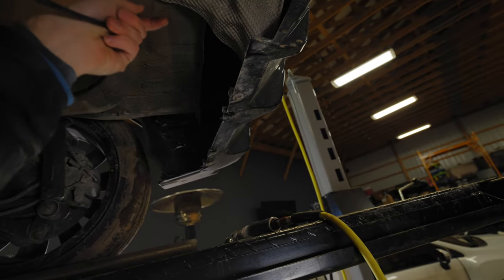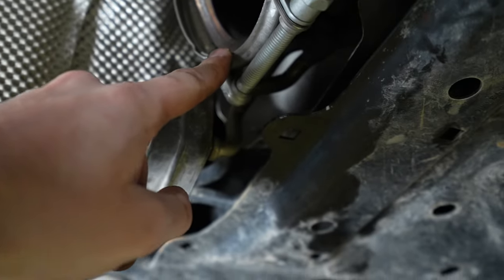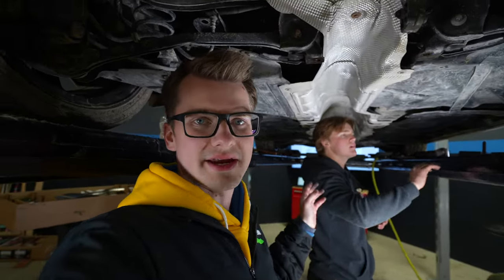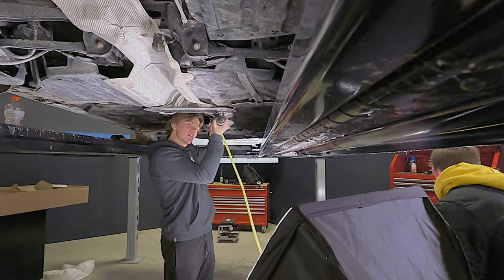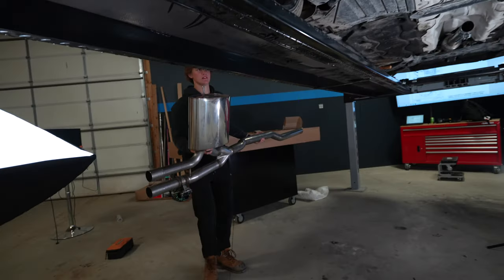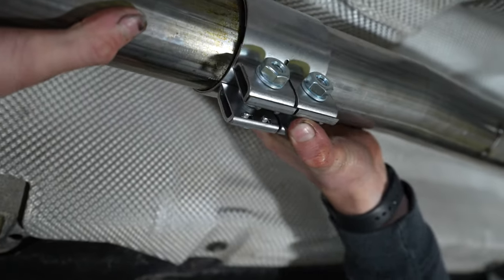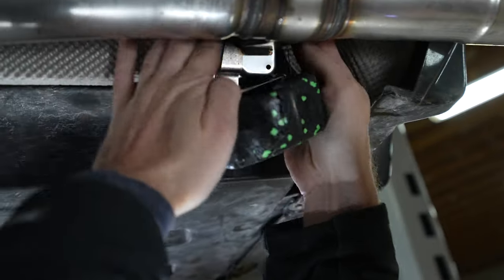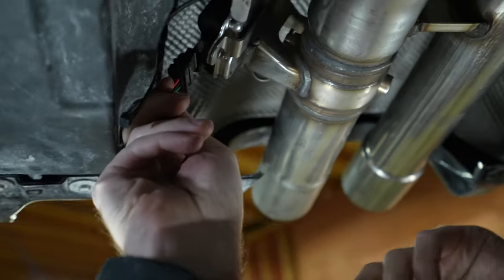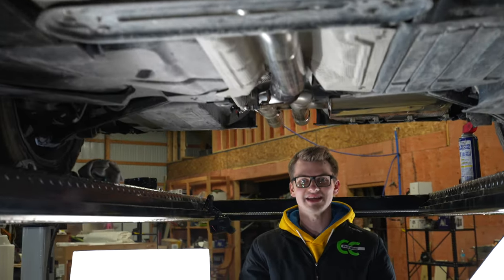The wire goes around the corner and connects to the exhaust. There are two bits — a basket-type clamp where you bend the tabs toward the back, then put the new clamp on and fit the pipe. We put one of the first brackets in to align the exhaust, then join them together. Now that James has done all the hard stuff, I can do the easy stuff — it just plugs in right here. It looks fantastic. Connect the battery, pair the remote, and we can test it out for the first time.